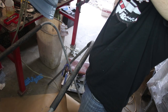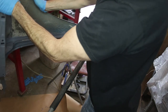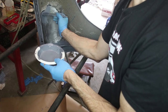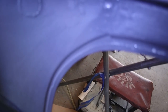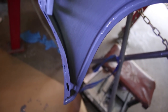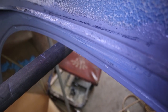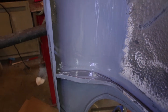I'm just lifting it up so the primer can drip out the bottom too — there it is, dripping out. I'm going to do this multiple times so I don't need to kill it all in one pass. You can kind of see how the stuff is dripping right there in the hemmed area, right like a seam sealer would. I really like epoxy primer in this situation because it's going to dry really hard and keep the seam protected from the elements. There's just one coat here, it's kind of sporadic, but this is going to do the job.